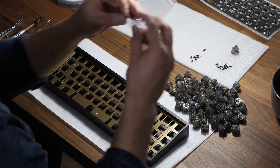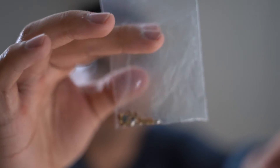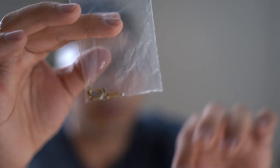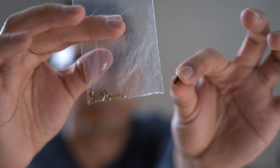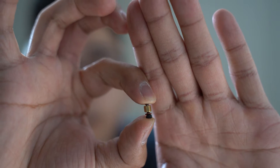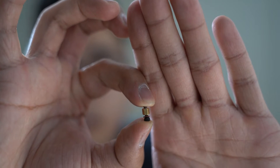I'm going to use what I will call the medium length screw — this is for the standoffs. The standoffs are right here. In this little bag there are these brass standoffs and Phillips head screws, and those screw together with this black piece. To give you a demonstration: the hex screw is on the bottom, on the side of the PCB, and above the PCB will be the brass piece — the standoff.